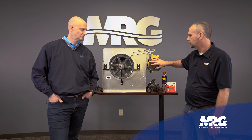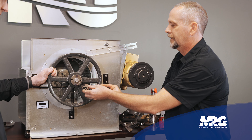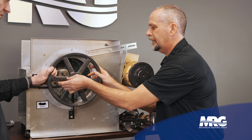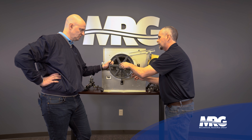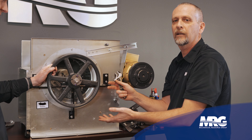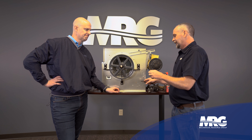The opposite happens when we push it off — it pushes it off to the smaller end. Hopefully this goes smooth. One thing to note: these bolts are not very high tensile steel, so nine times out of ten if this thing had been ten years old, I'd be about to snap these bolts because it'll be so seized and rusted. It's a good idea — take the bolts out, they'll come out easy, but when you go to push them apart, a lot of times you'll have to put so much torque that they'll simply break. See how nice and easy that pulls off when it's brand new? That collar comes right out — it never happens like that in real life.